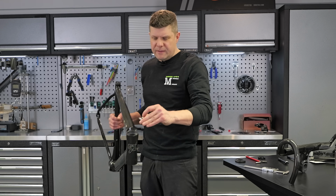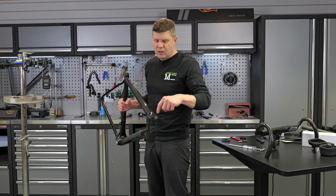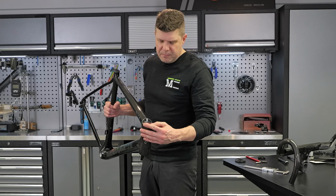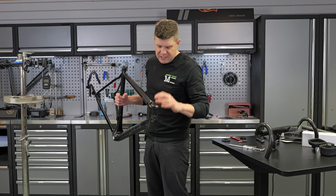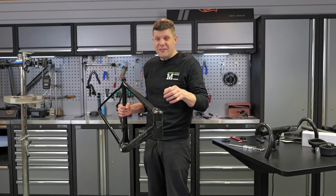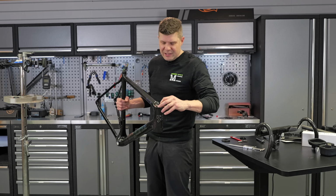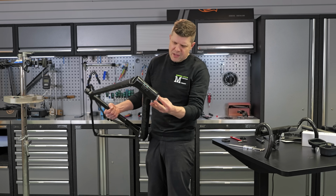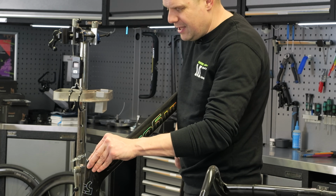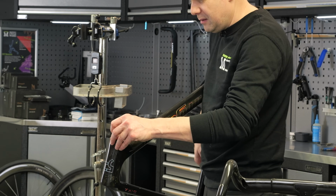So I've measured this is 51.8, and the inside of this is only ever so slightly bigger. You are not going to be able to squeeze in a 52mm, but this is a beautiful, beautiful fit. That sits so flush. It's so nice when components are so well made, they just slot together and just feel like they're made for each other. I mean, solid fit, beautiful. And the same on the bottom, just drops in and then does not move around. There is not a hint, a ridge, a burr, anything preventing that beautiful finish.